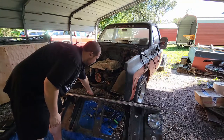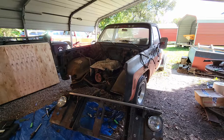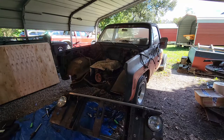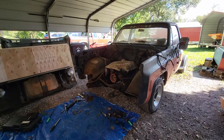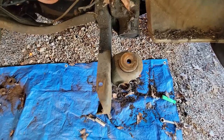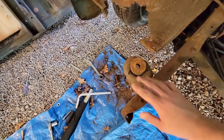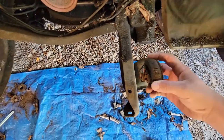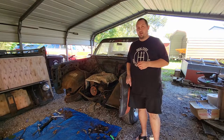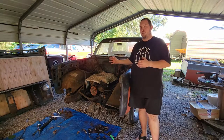There she is — those four bolts were the last four that I hadn't noticed. Now that should be a lot easier to pull an engine out. That was actually a lot of work and some pretty tight clearances for getting that thing in there. I really need to get in better shape — I should not be out of breath after that. The part I didn't expect: that thing isn't really even all that heavy, maybe 50-60-70 pounds, not bad at all. Now that the core support is out, these are the body mounts — the other halves — they just pick right up off the frame. You can throw them away and replace them with brand new ones, which trust me is long overdue. Look at the rubber on these things — it is done.